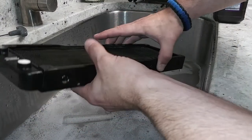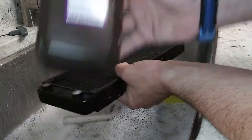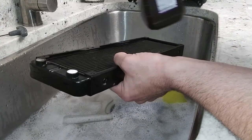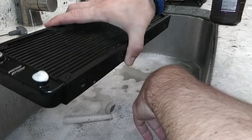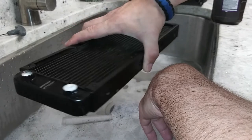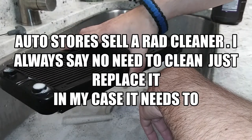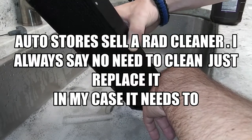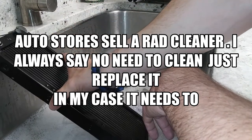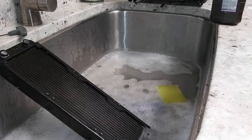This radiator is almost not of any use to me — I didn't realize how much corrosion was in there. Take peroxide, put it in there, let it soak — look at that, it's getting all that crap out. It may take a while to break that loose, but if it can't we'll have to replace this $65 radiator. We're already replacing an $85 block. All right, let's go back in the room and work on the PC, converting it back to air cooling.